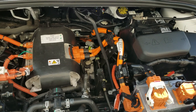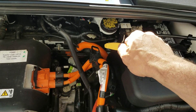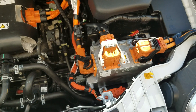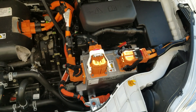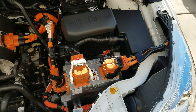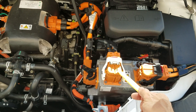It's probably best to talk about how it works. The power source is the battery power that comes from that cable back there. It comes up around through here and makes it to this connector. This is high voltage DC, about 364 volts at a full charge. This box here Ford calls an EVCC — electric vehicle computer controller. I would have called it a high voltage distribution module, because it distributes the high voltage DC electricity.